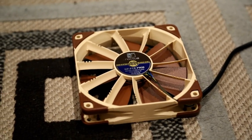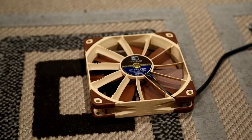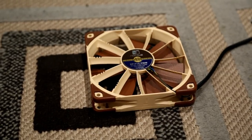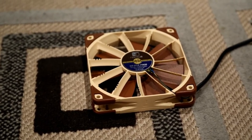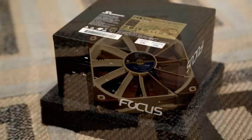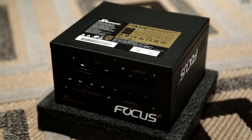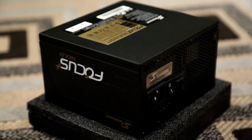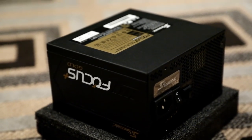To help keep my computer cool, I bought two 120mm Noctua NF-F12 fans. They're so ugly, but they're consistently referred to as one of the best fans for both noise and keeping things cool, and I was putting them at the bottom of my case anyway. Powering all of this is a Seasonic Focus Plus 850W power supply rated 80 Plus Gold. I was considering 80 Plus Platinum or Titanium, but the price difference was too much, and for what I'll be doing, I really don't need anything above Gold.